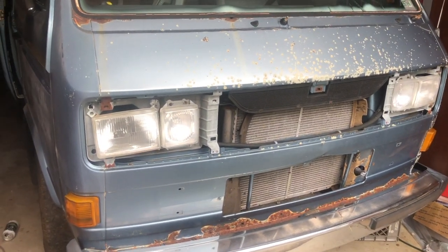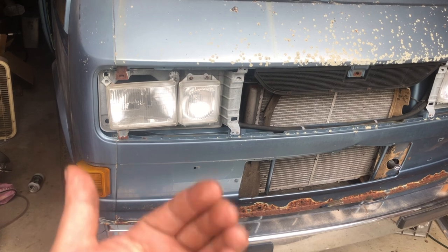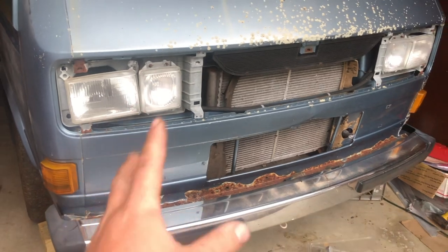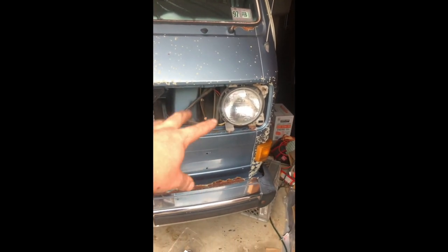What I like to do is remove the square headlights and put the earlier round headlights on — single rounds, not the South African four-rounds, but single round headlights from a 1980 to 1985 Vanagon. I personally like the look, and I can get real cheap seven-inch round headlights — the Jeep aftermarket LED ones — with spectacular lighting. The round headlight assembly sits in a headlight bucket with its own adjusters, but the back connector is different, so you can't just plug your square headlight wiring in. You need to cut the three wires and solder on a different pigtail. I've mounted them but haven't wired them up yet.